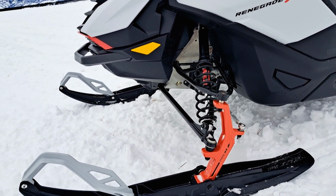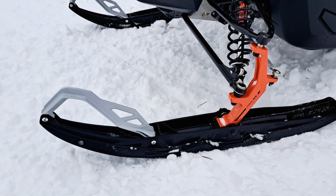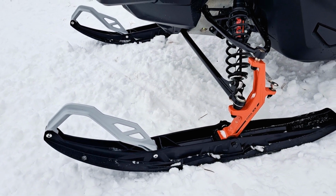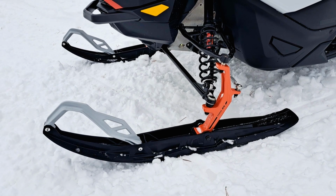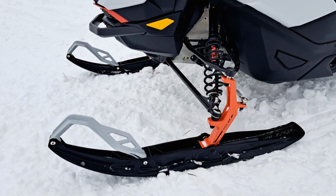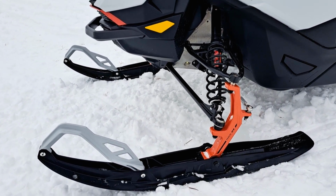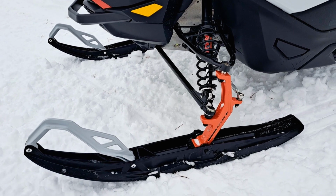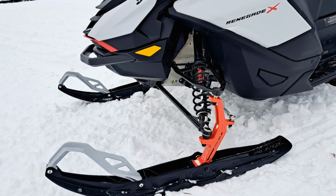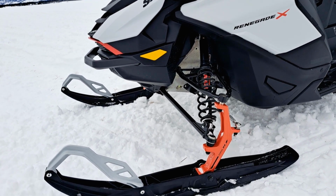What Ski-Doo did is, first of all, this is not the Pilot RX ski. That's the Pilot X. Now, when they did that in 2025 in MXZs, an in-season model would keep the Pilot X ski, and a spring model, an X or an XRS, would get the new Pilot RX ski that had certainly a different keel and a different setup overall. We were real frank. The RAS RX front end made a big difference. The RAS RX front end with the Pilot RX skis made a huge difference.